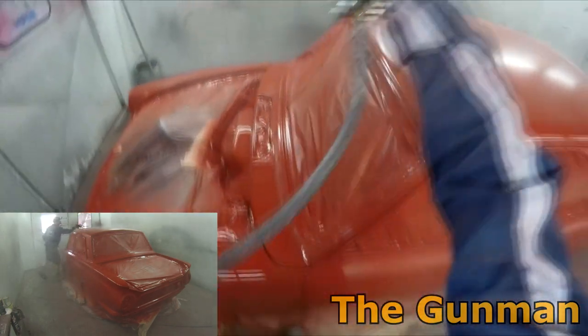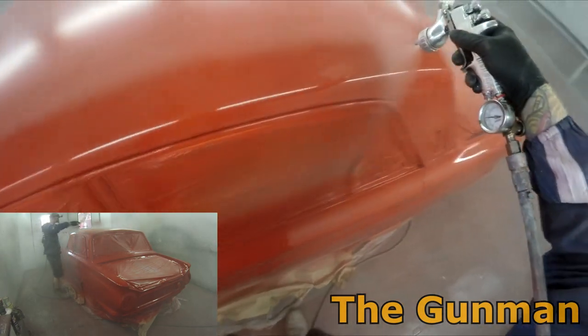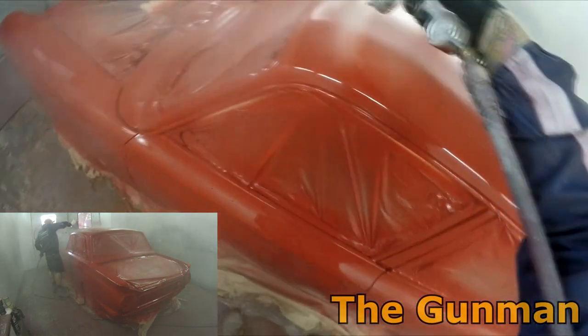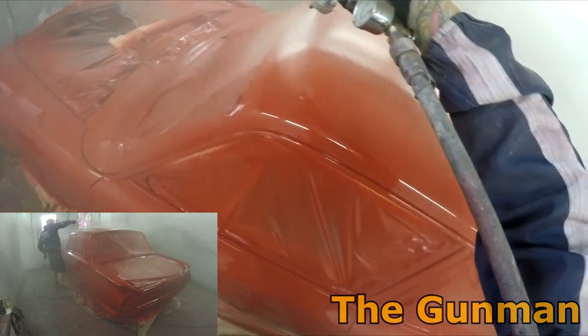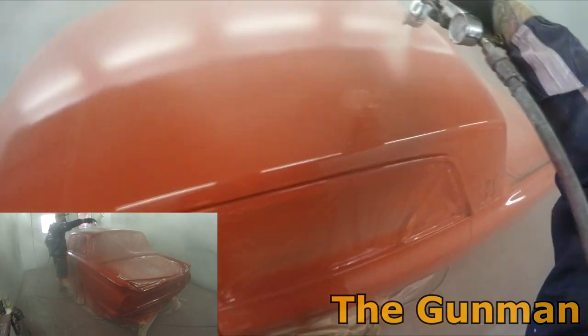I have made a mention of this in a couple of videos before, but all you do with the Glasurit high solid 255 clear coat, you would go 10% reducer, I'd mix it all up on the scales, and just about every single job I would be left over with two drops of paint, because I had this technique down pat.